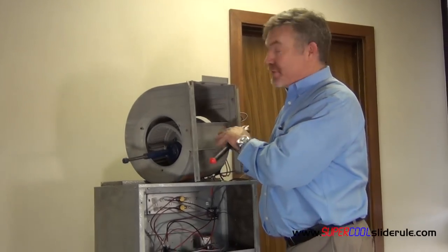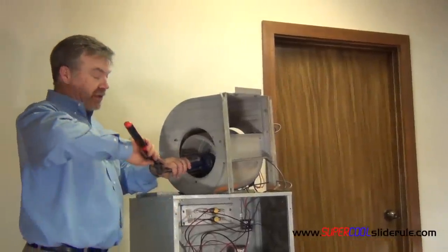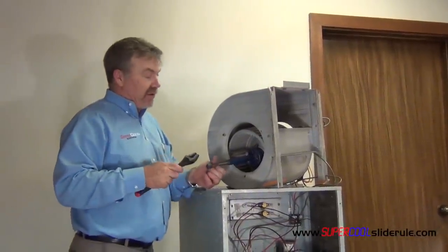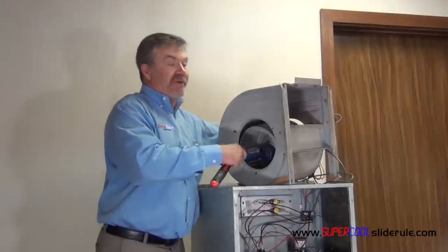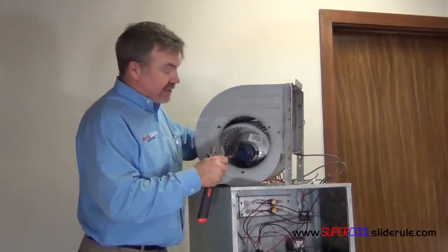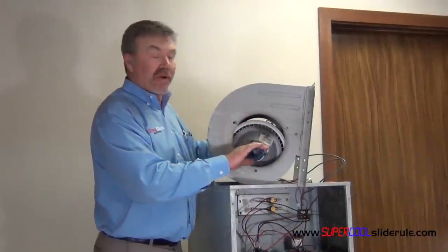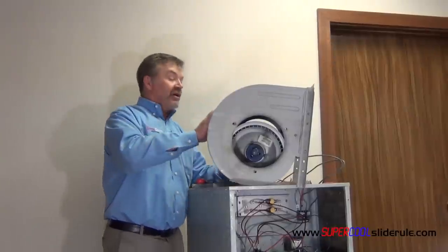I've got the motor completely loose and the blower wheel is still attached. All we do is tighten the hub puller clockwise until the motor comes off. Pretty simple — you may want to support the motor on the other side. Don't manhandle it; this thing is kind of sensitive, so just be careful. I've completely tightened my hub puller, the motor is now loose, and I pull it out.